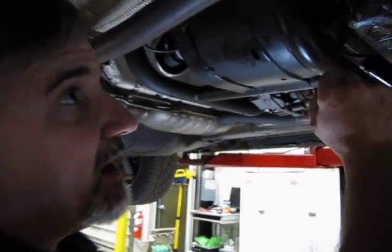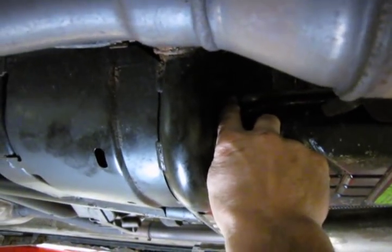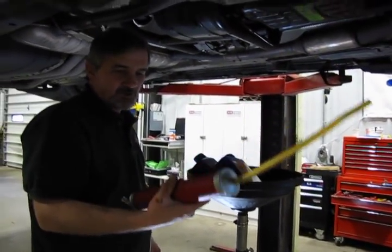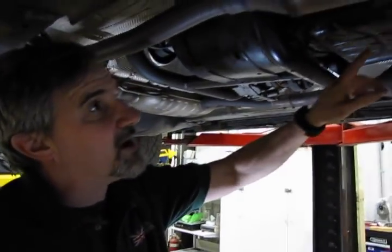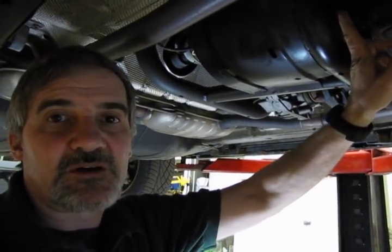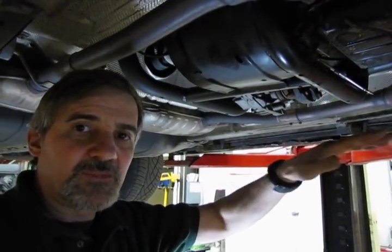So with an 8mm Allen head socket driver and a breaker bar — I wouldn't suggest using a short ratchet, you won't be able to develop enough torque — with a longer breaker bar we're able to crack that loose and we got the plug out. So now what we're going to use to refill it is what's referred to as a suction gun. These can be purchased in any automotive center and they're relatively inexpensive. What we're going to essentially do to start off: it'll probably take about 2 quarts to fill the bottom of the pan. Then we're going to put the plug back on, start the vehicle, get the temperature up to operating temperature somewhere between 85 to 105 degrees centigrade, and then with it running, back underneath the vehicle, remove the plug and continue to fill until we've got fluid dripping out of that hole about one drip every second — then you know your level's good. Cap it off and you'll be good to go.